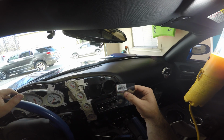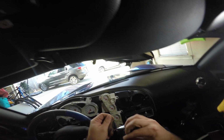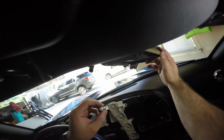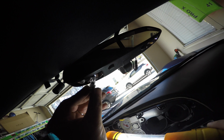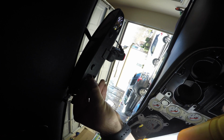So again, to show you which bulb I'm using in here, this is the 194 CWHP5, cool white, 360-degree angle, and they just snap into place, as you can see. It's kind of hard to see in there, but you see where that grabs up there? It's literally straight up. A little tricky, and these only work a certain way, so test it out immediately. Boom. Make sure they're on there. They both work.